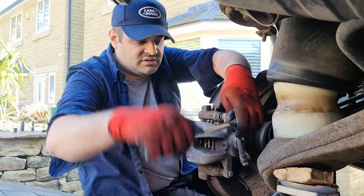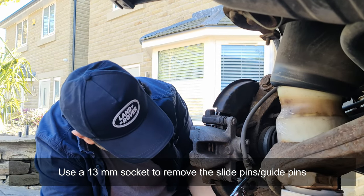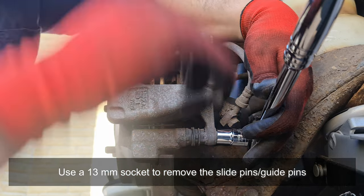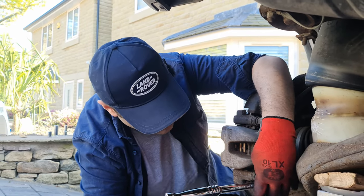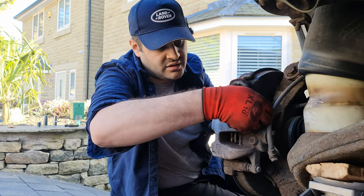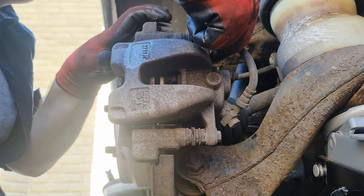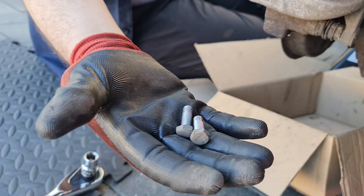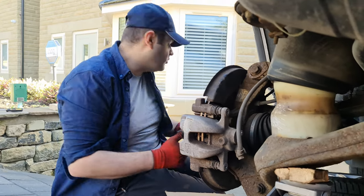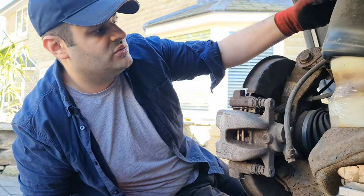The second sliding pin is here. They are 13 millimeter socket. Just simply remove them. They look like that — I can see they have not put thread loctite on the bolts when they installed it, so I don't know what kind of work they did. I'm just going to redo their work.